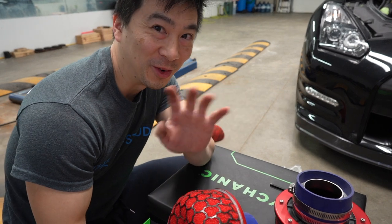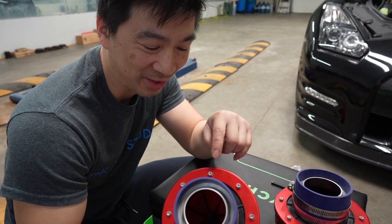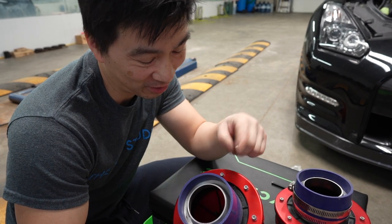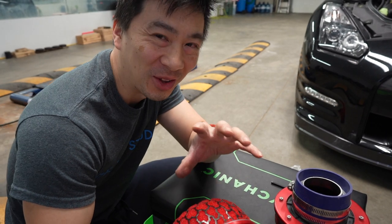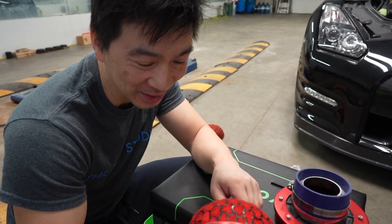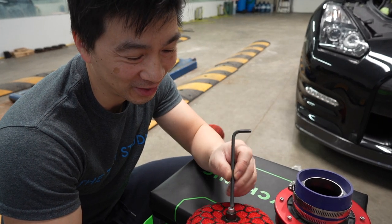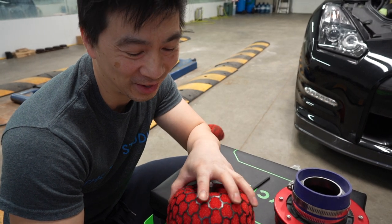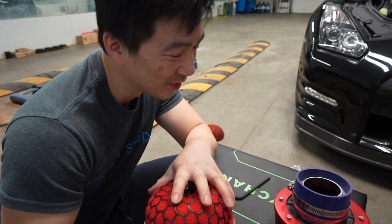Okay, abort, abort, abort. Okay, cancel. Do not take the little bolts on the back, the number three Allen keys. Don't take those apart. It's been such a long time since I've replaced these, you guys. All you have to do is take the number 5 Allen, take the bolt out, and the cage comes off. So, complete fail, you guys.